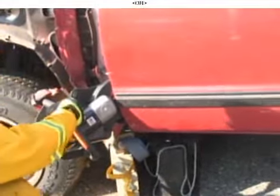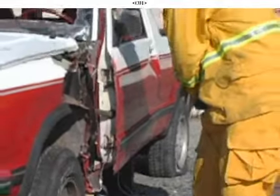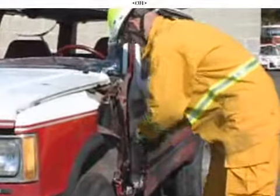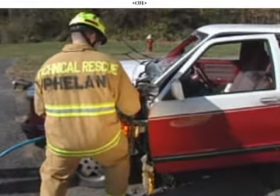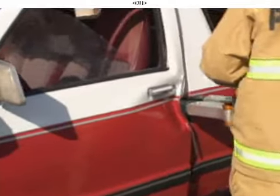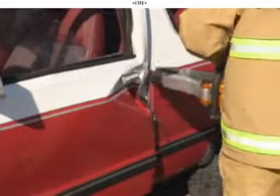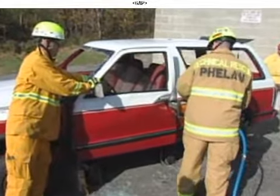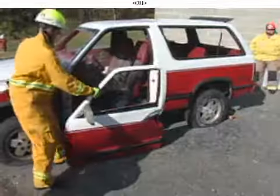Mike stopped and used a hand tool — a cable cutter — to cut the wiring between the door and the body of the vehicle. The reason we need to do that is because a lot of our body structure in vehicles, doors, and roofs now have safety systems built into them. We need to make sure wiring is severed with a hand tool, because our hydraulic tools can produce a static charge. We don't want any back-surging of static into the wiring that has the potential to set these devices off — however unlikely, it is a possibility we didn't encounter a few years ago.